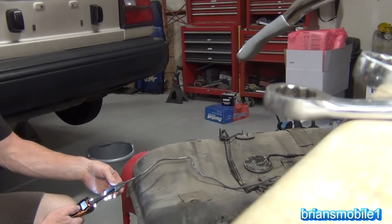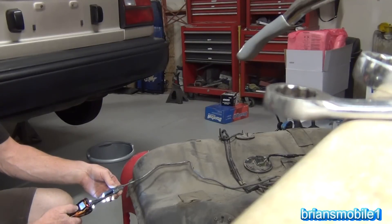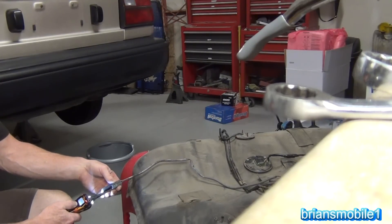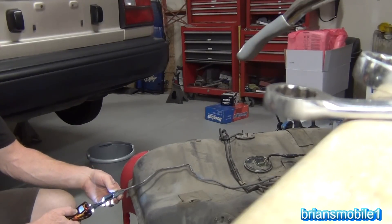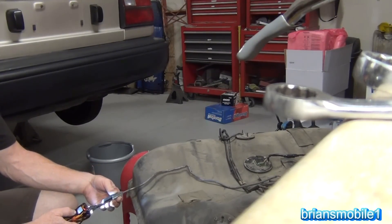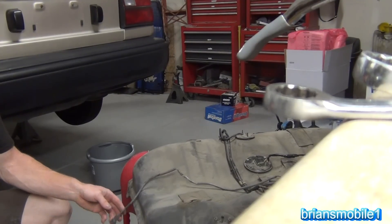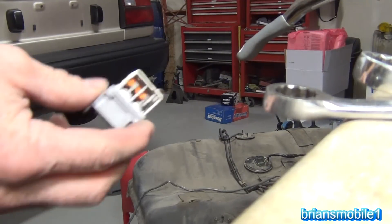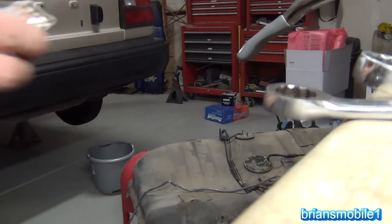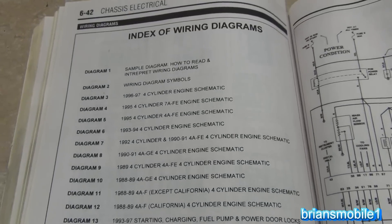This fuel tank is really rusty. When I was trying to empty the tank to make it lighter to go back in, I found it was pouring orange gas - you've got green diesel and instead of straw-colored fuel it was like orange fuel, orange with rust. So maybe that has something to do with the seldom-failing circuit opening relay burning contacts - maybe it was getting messed up from that.